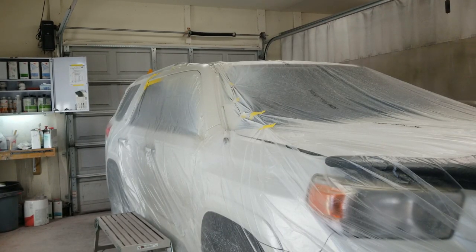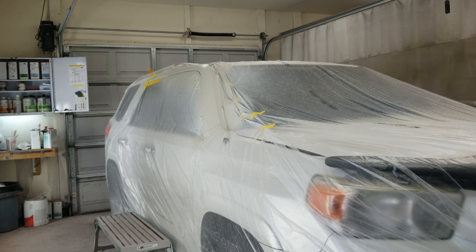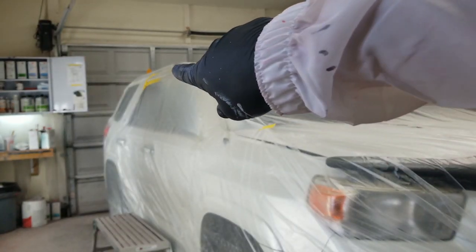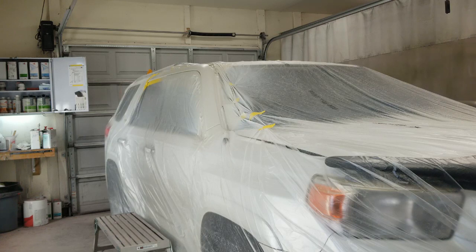It looks good. I've got a color card that I matched it to from using the same color mix about a year and a half ago. So I'm gonna go ahead and just clear it now. Wait about 5 or 6 minutes between coats, and then I'll go to thin my clear, and I'll go back to the back there, and I'll just spray some really thin clear out over that final edge back there. And then tomorrow I can kind of wet sand that back with 2000 and 3000, and I can just polish it out and it should disappear.